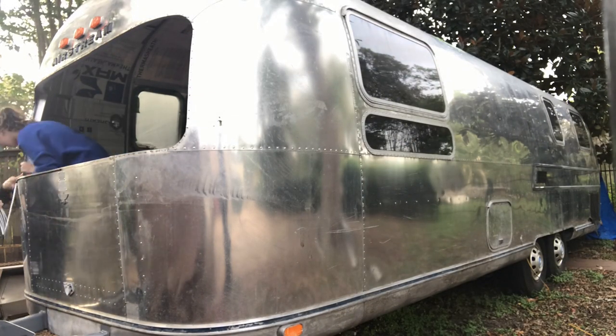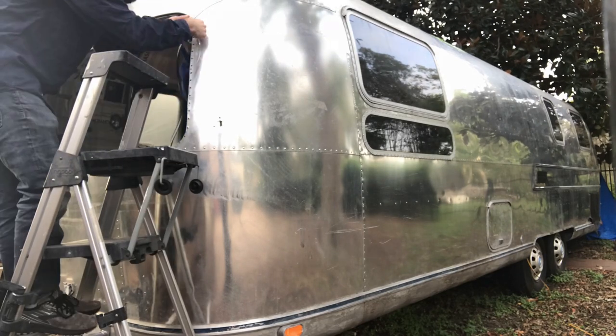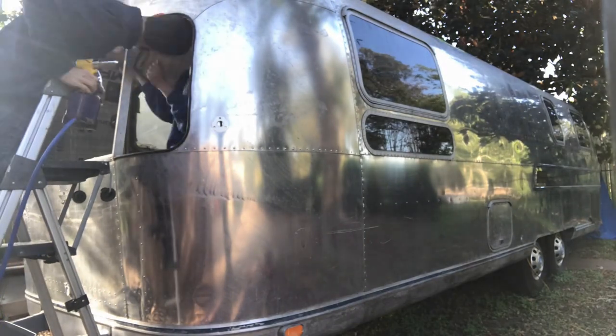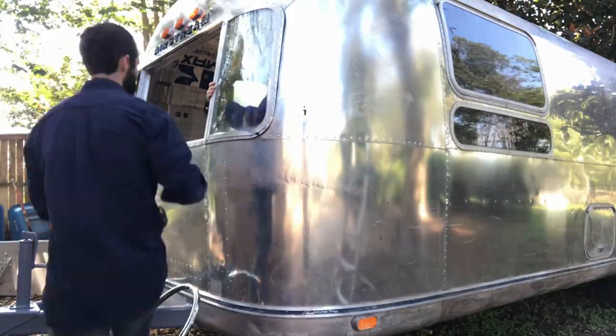The hope is that once all of these things are riveted to the frame of the Airstream, that structure will hold everything in place where it's weak. We really don't want to replace the windows — it's like three or four hundred dollars a pop, so if we can make the old ones last at least for a little while, that's going to save us a lot of money. In my experience, the gasket is not exactly the most useful thing to use here. I would definitely recommend using some thick caulk in place of the gasket, because you have to drill through the gasket to put the rivet in, which basically messes up the seal. Sometimes you wind up twisting or breaking it — it's really just not the most effective way, and we wind up having to seal it with caulk anyway afterwards.